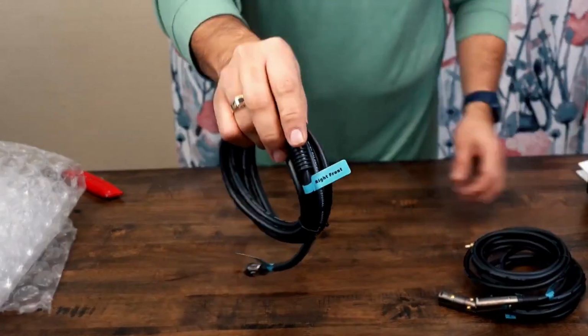My Anthem MRX 1140 does not have XLR outputs, so I did have to get the XLR to RCA cables. Originally Dylan was recommending the Monoprice brand, which are the ones that I got, but lately there had been some issues with some of the batches, so he no longer recommends them. However, the ones that I got turned out to be good, so I haven't had any issues. I should mention that the issue they noticed was a lot of noise being caused by the cable itself, because once the cable was replaced, the problem went away.